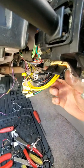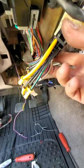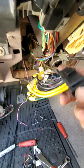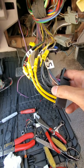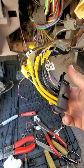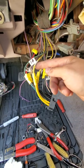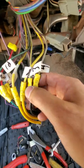Here's your cluster — plugs in just like that. This bottom one's the only one that doesn't have a wire to it. So I marked them as one, two, three, four, five, six, seven, eight, nine, ten — so ten's on the bottom. The last one is the green one. Yellow is yellow, and then black is number three.